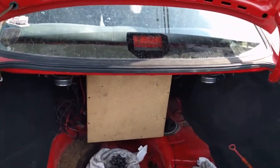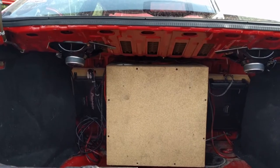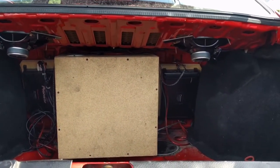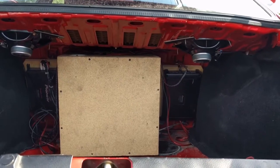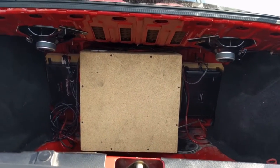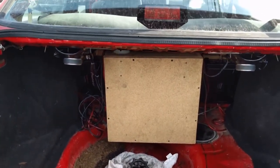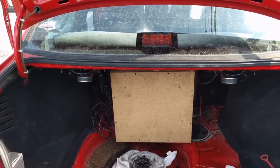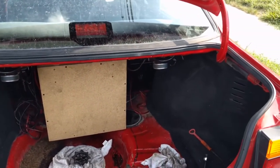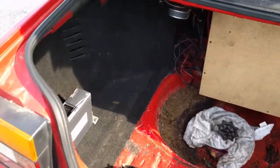we've got most of the sound system installed. 1200 watt 4-channel amp on the left side. 1200 watt at 4 ohm. Mono sub amp on the right. 12-inch Pioneer dual voice coil champion stuffed in the box there, which seals into the cab so that there's very little vibration in the trunk, so I don't have to sound deaden this thing because it just adds weight. Had a little oil spill this morning, so we're cleaning that up.